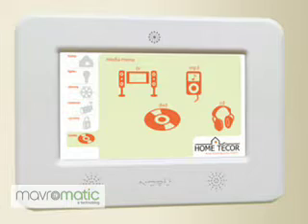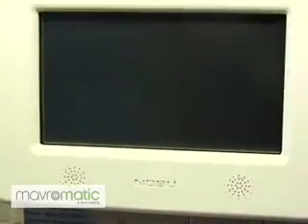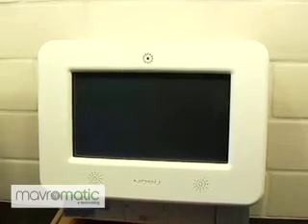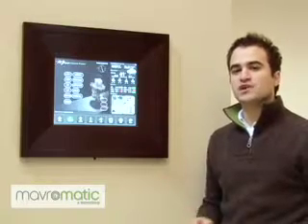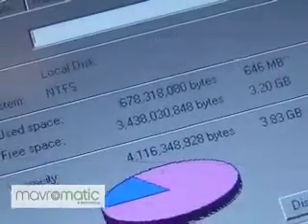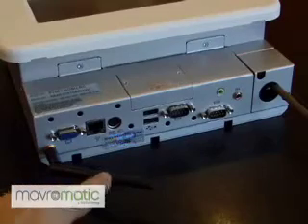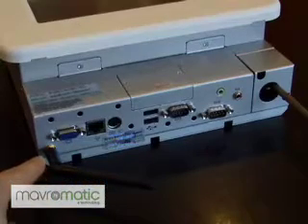However, if you're planning on installing a home automation touchscreen controller for a client or in your home and don't want to mess around with putting components together, then this Nobu N8W-TS10 should be considered. The Nobu 8-inch in-wall touchscreen runs a 1 GHz Intel Celeron M fanless processor using an Intel 852GM Plus ICH4 graphics chipset. The unit is fully loaded with 1 GB of memory and a 4 GB flash drive which is industrial rated for wide temperature use — needed since this unit will be installed in a wall. This particular unit also has a built-in Wi-Fi G&B card as well.